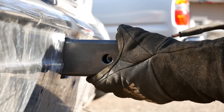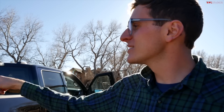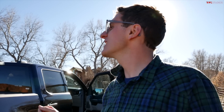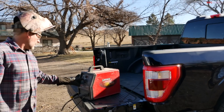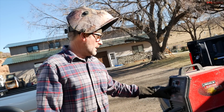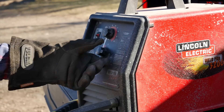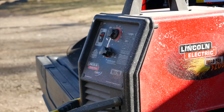It went straight into the red and said we exceeded the maximum capability. We pulled 3.6 kilowatts out of the 110-volt outlet and it blew. We'll try resetting it and give it one more shot. I'm going to tone it down a little bit — I'm at my highest level right now, but the bumper is a little thinner so I don't need it that hot. I'll go down a notch and see if that helps.